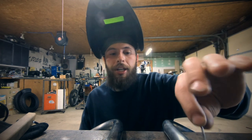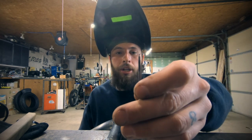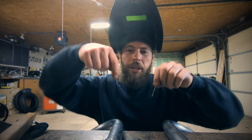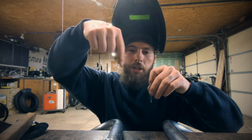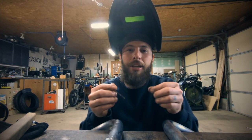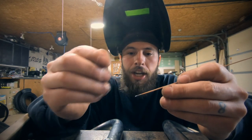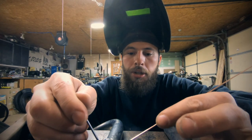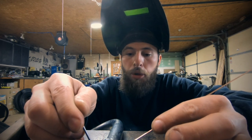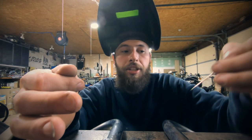So if you're welding and you get a little contamination and it hops up onto your tungsten, you don't have that nice, sharp tungsten anymore. Now your arc wants to wander around, and it makes it really difficult to get a nice, tight bead. The heat circles around as you bring your rod in, and you'll get your filler rod to burn off before you get into the puddle. It creates all sorts of issues that make it really challenging to have a nice weld.